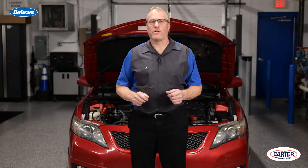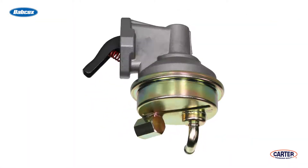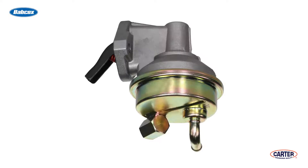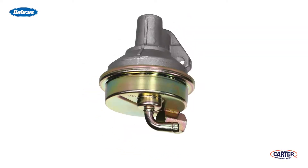Sooner or later, you're going to have one in the shop, and you'll need to know the basics to diagnose a fuel system problem. Most mechanical fuel pumps are driven by the camshaft. There is a lever that extends out of the pump, which in turn either rides directly on a camshaft lobe, or in some cases, there is a push rod between the lobe and the pump lever. The lever pivots where it enters the pump, transferring motion to a diaphragm and valve assembly, which pressurizes the fuel and delivers it to the carburetor.